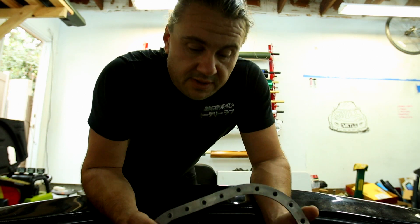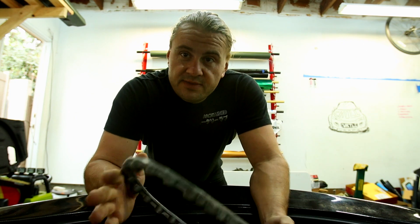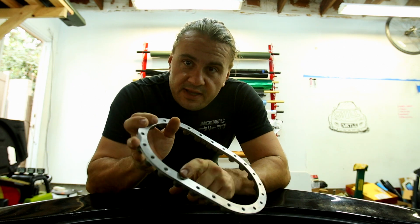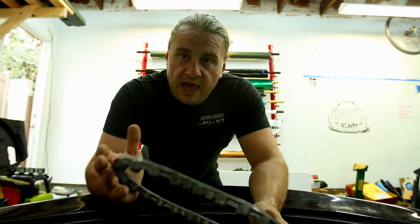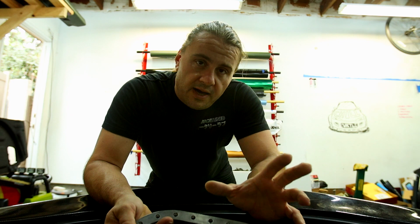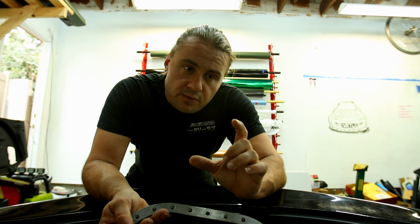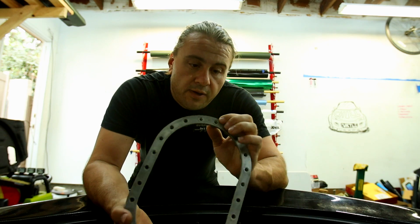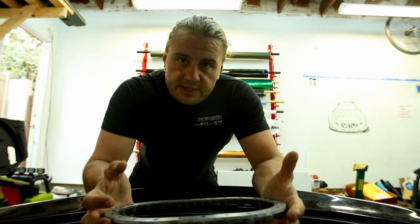There was a lovely drive back to the garage today — nothing but fumes of 91 octane. Nevertheless, we did get the part we needed. We got the threads remachined inside here so we can go ahead and put the screws in and actually have them hold. We went ahead and got slightly longer screws — we had seven-eighths of an inch before on the screw length, and we went ahead and did one inch, a little bit longer, which is gonna allow us to grab a little more thread.